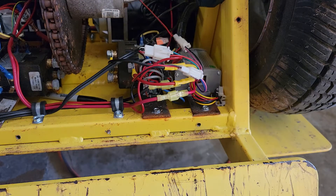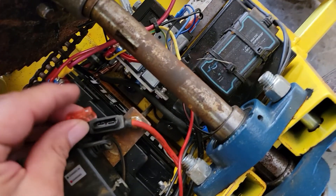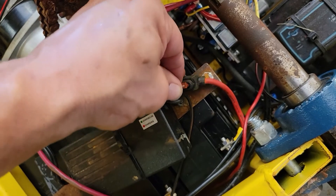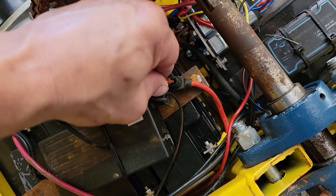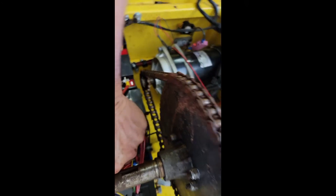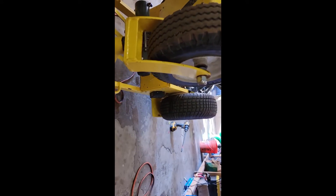Now we're going to put the fuse back in. When you put these fuses in, sometimes they will pop and spark — that's normal. Don't worry about it. Take your time, make sure it gets in there properly, and don't force it because it'll mess up the terminals inside the fuse holder. Once the fuse is fully seated, close up this little cap. Now we're ready to test it: turn it on, go to forward/reverse, make sure you hear your clicks, then hit your throttle and make sure it turns.